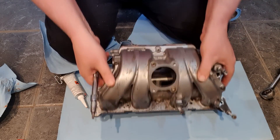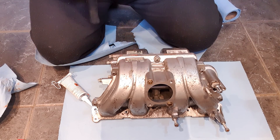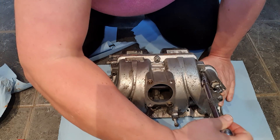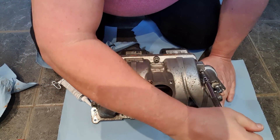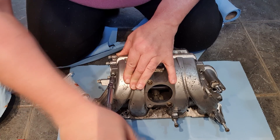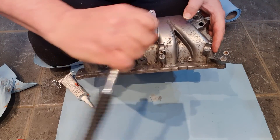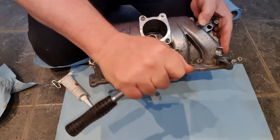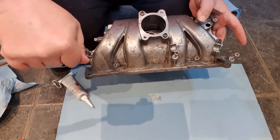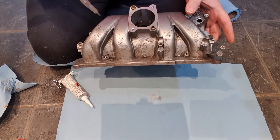On the subject of torque wrench settings - a lot of people just say yeah, do it up until you can hear the bolts start to creak, or just about to snap off, which is not really the right thing to do. But a lot of things like this, non safety-critical components like this, I don't really bother too much with torque wrench settings. With a little bit of experience you can just sort of work out that yeah, that feels tight. But things like cylinder head bolts are safety-critical parts, like braking system parts - it's a good idea to actually torque them down to the manufacturer's torque settings. In fact with the head gasket bolt it's essential that you do that, otherwise you can get the head twist or crack, and that's an expensive hobby.